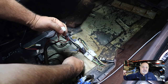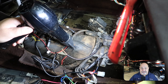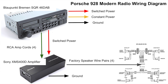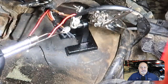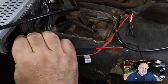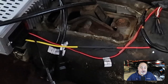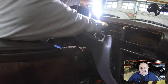Working methodically, making sure I hooked up the right speaker pairs, then shrink-tubing and soldering everything. The trim cover fits in and you can see me stuffing the preamp outputs into the unit. I realized all the old wiring was no longer needed, so I pulled it out while the carpet was up. Extra wires from the old aftermarket radio were capped off with shrink tubing. At that point all I needed was constant power, switched power, and a new ground — much, much simpler wiring. Once I confirmed all the wiring was working and the sound was decent, I could move on and put it in the center console.